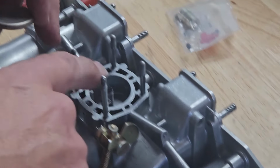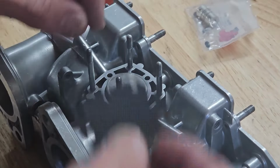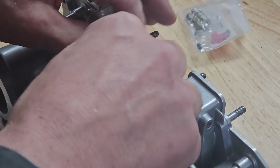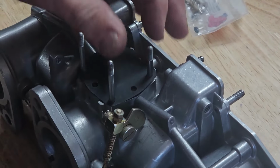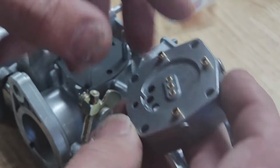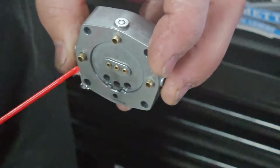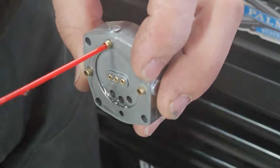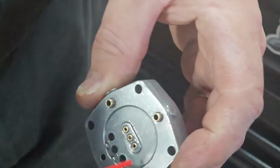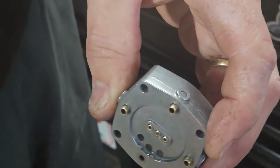This is our pump check valve system. We have a spring, a disc, a diaphragm. And that diaphragm works on these 3 ports right here, and this effectively shuts fuel off. And these 3 ports, which are going to flow right now, allow fuel to flow through here and out to all the accelerator pump jets.